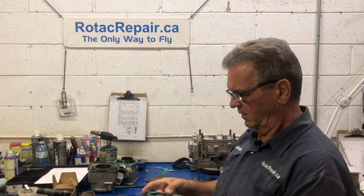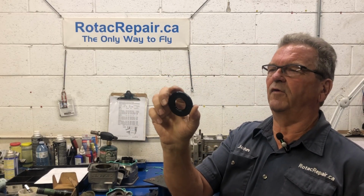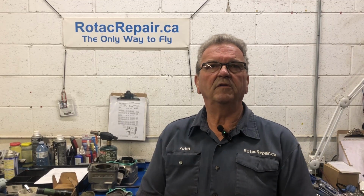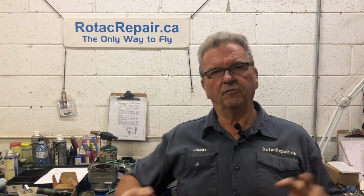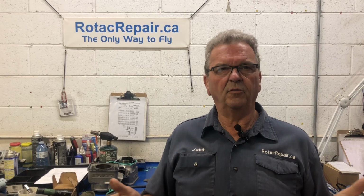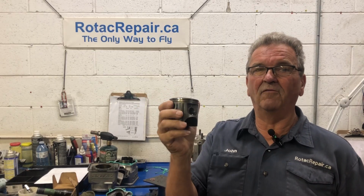So then we have the water pump not assembled correctly, the impeller's rubbing on the housing. We have cheap, not aircraft, parts. This is the seal from the mag end of the crankshaft. And all the debris that was made from the failure of the piston, all of the debris that went through there ruined what otherwise was a good crankshaft. Yes, it needs new bearings because they put non-aircraft bearings on it. And then, of course, the one connecting rod on the cylinder had the failure. It's 60% worn already. The other cylinder is within new specifications. So these cheap pistons really ended up costing an awful lot of money, unfortunately.